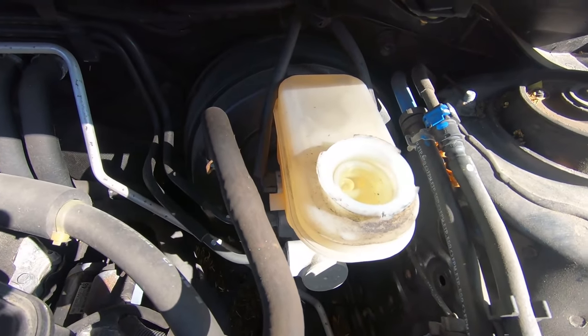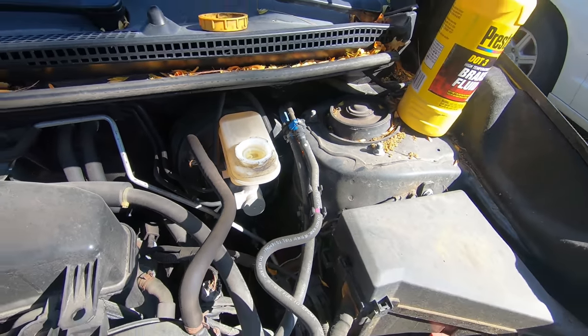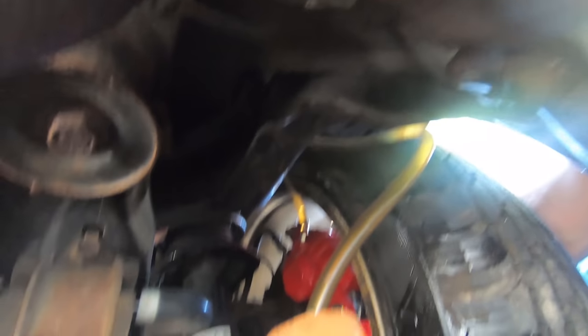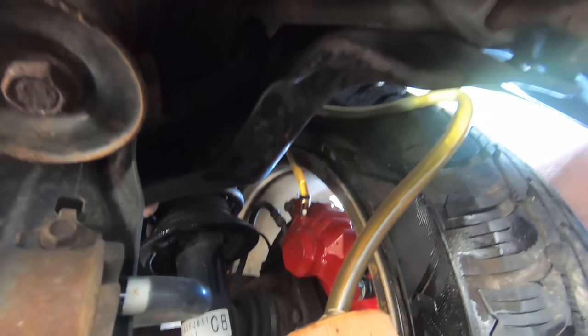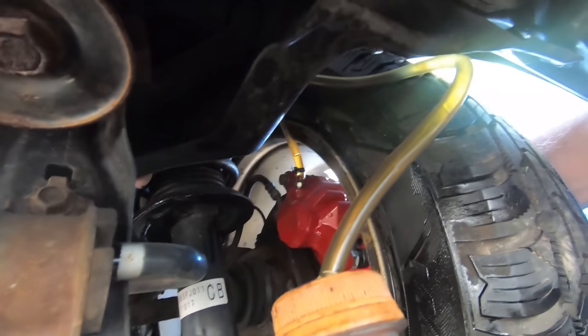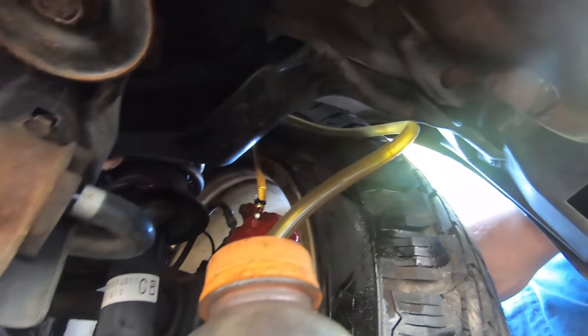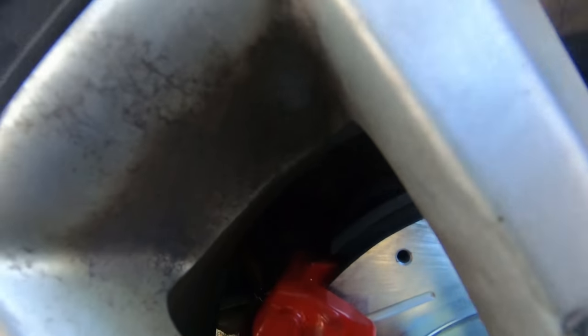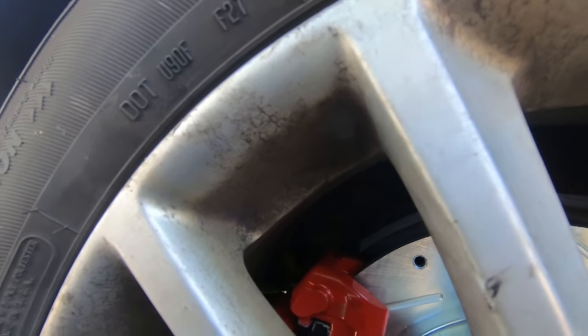I've got the reservoir filled up to the very top since I'm going to be pulling the fluid, and we'll start in that back. I've got the bottle set up for the gravity bleed — as long as this hose goes in an upward direction, air won't go back in. I'm going to pump the pedal a few times. The fluid's already pretty clear so I'll be a little excessive — maybe pump it seven or eight times rather than five, just to make sure we've got clear fluid all the way through the lines. You can see on this side right on top of the caliper it's creeping as well.